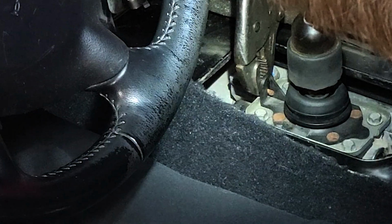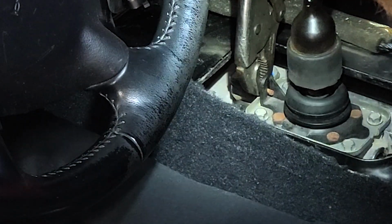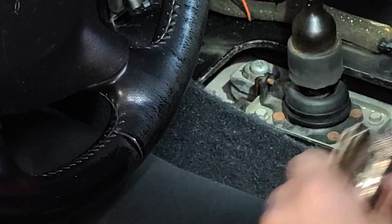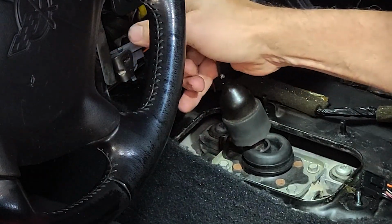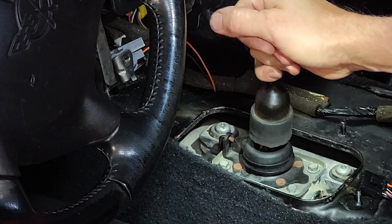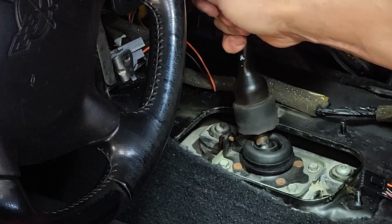And when that is done, you can slide the alignment pin back up where it is stored until you need to use it the next time. Pretty slick, I'd say. Now, before you go any further, take a moment to run the shifter through all of the gears so that you're 100% sure that you did it correctly and it shifts as it should.